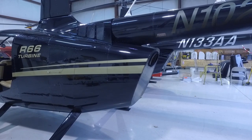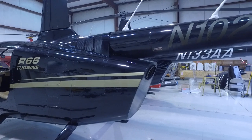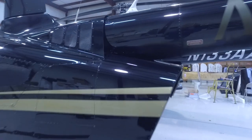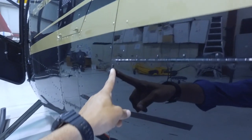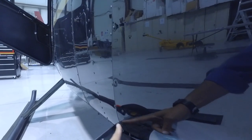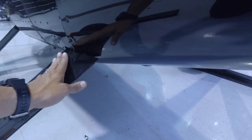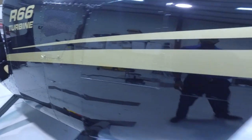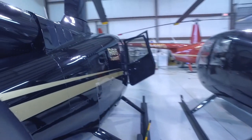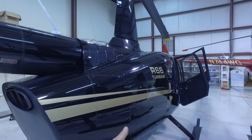We need to remove the aft cowl — it goes from about there to there. We're going to remove this screw, leave these engaged, then remove these screws. There's going to be a trick here: we want to wipe this with isopropyl, just remove the dirt, and then put tape here so when you remove the aft cowl it doesn't chafe or scrape. Same thing on the other side. Leave these fasteners engaged for now and remove the screws going down.